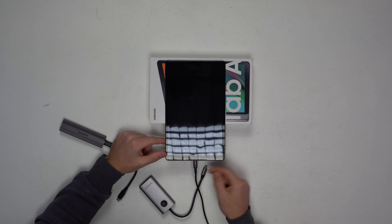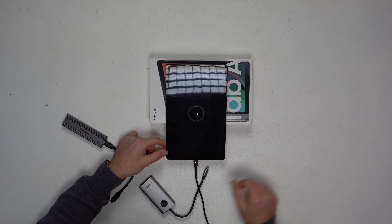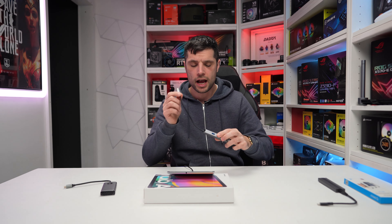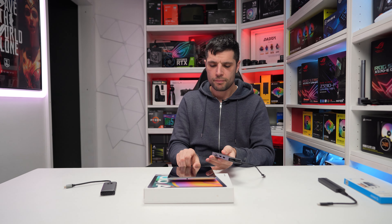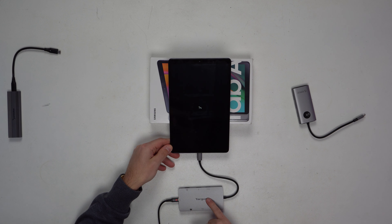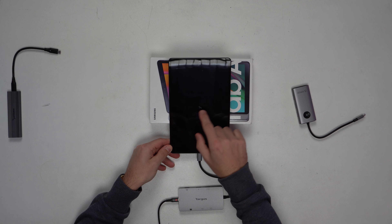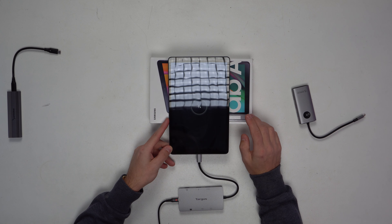Now I've connected my USB charger to the 100-watt charge point and plugged it into a tablet that was very low on battery — I did it on purpose to see whether it would work. We were on zero percent a second ago and it's now charging at one percent. However, when I then tried charging through the docking station itself, it didn't provide enough power to actually charge the tablet while plugged in. The cable indicates charging with a red light and turns blue when charged — no problems with the cable itself, just something to be mindful of.